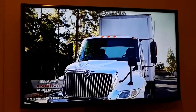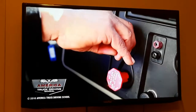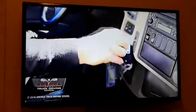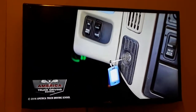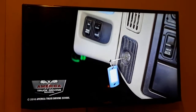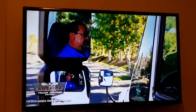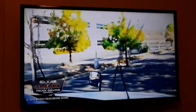Next we will begin our cab inspection. To begin we will start with the safe start: make sure our tractor and trailer brakes are set, the transmission is in neutral, and then start the engine. While we wait for pressure to build, we'll address items inside the cabin. First are our mirrors — make sure they're clean and properly adjusted. Our windshield and rear window should have no illegal stickers, obstructions, or damage. Wipers and washers: the arms and blades must be secured, not damaged, and operate smoothly. The washers must work.